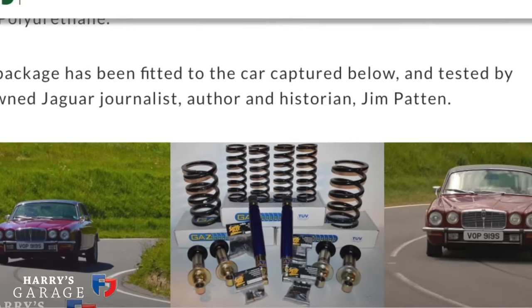Anyway, that gives you a little taste of the fully rebuilt Jaguar XJ Coupe. The transformations came in three forms, I think. Gearbox first, the fact it's a manual gearbox makes it completely different to the three-speed auto slush box it had in period. Second, the handling kit, you can see it just transformed. It's nothing like a regular XJ at all. Third, I suppose actually the body and the fact it's structurally stiff and what Painting Classic Cars did to the car there. I now have a structurally sound, as new in effect, body shell, and all sealed, all waxed.